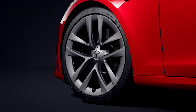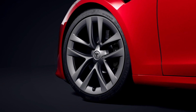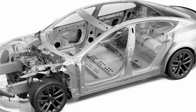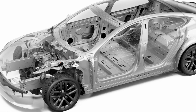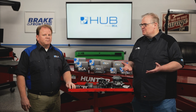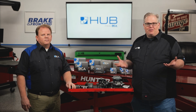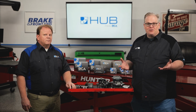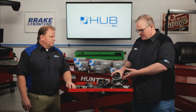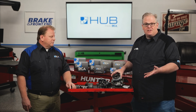But both models need high quality wheel bearings that can withstand the electric motor's instant torque and the hefty curb weight of 4,300 pounds. This is the same weight as, let's say, a Chevy Traverse or a Jeep Wrangler. Both the front and rear hub units are held to the knuckles using 4 bolts, just like a lot of other vehicles out there. They only require 65 foot-pounds.